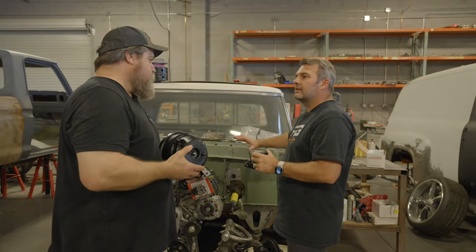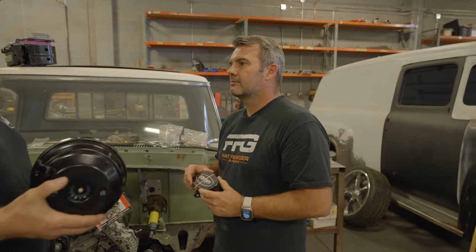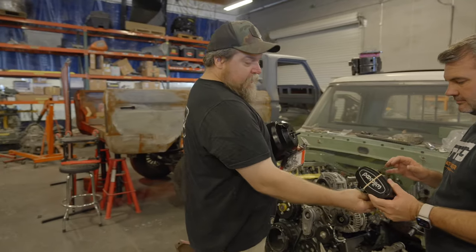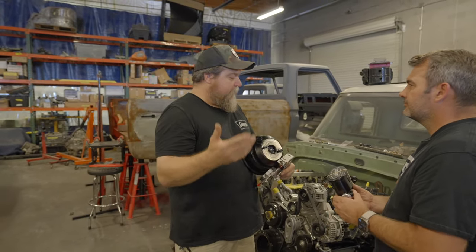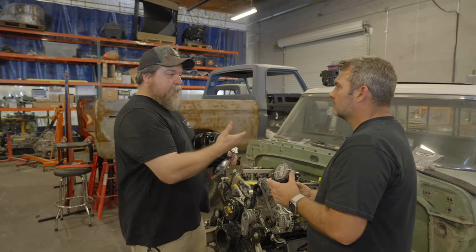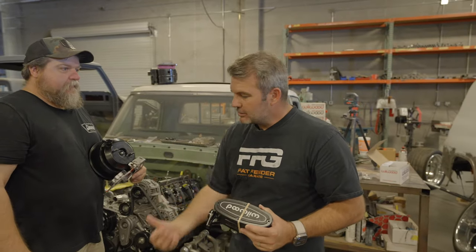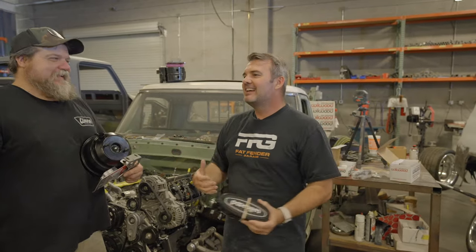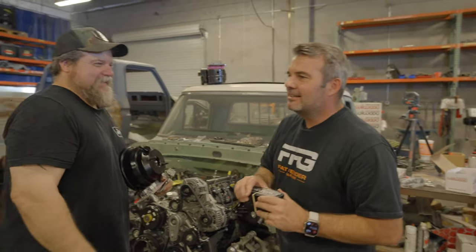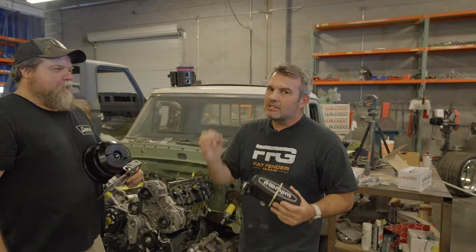Once you've bench-bled and it's working like it should, if you still have bad brakes, the first thing to check is: do I have any fittings anywhere in the truck that are leaking? Wilwood uses aluminum washers between all their fittings — make sure those are tight. Check your brake whips for leaks at the calipers. An easy trick: take a gray rag and rub every little fitting. If there's nothing on it, you know you're tight.